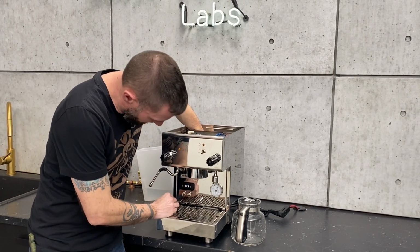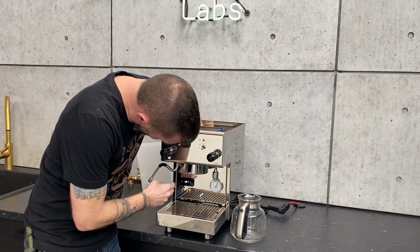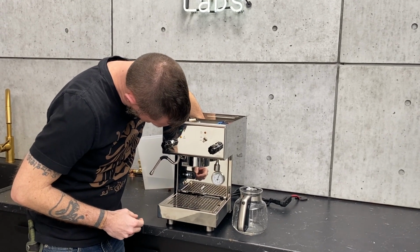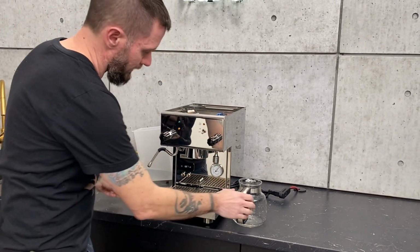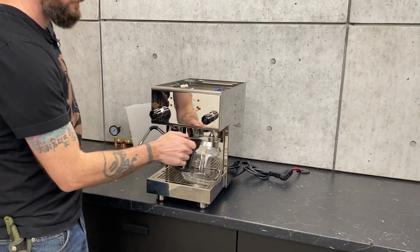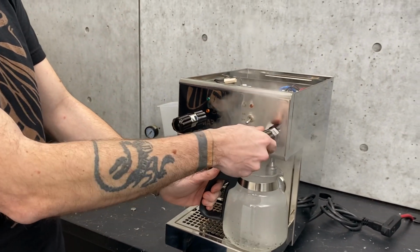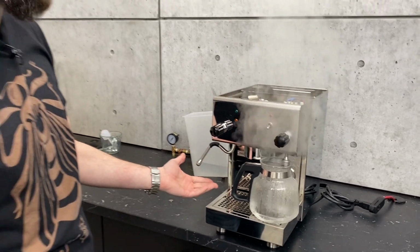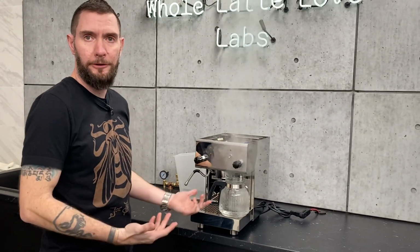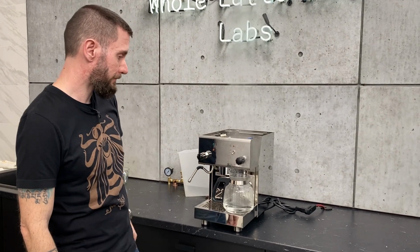I've seen it done before, but so make sure that I got this steam boiler heated up all the way. And click. All right, it's fully heated. So what I'm gonna do is turn the machine off, find some sort of vessel that fits underneath here, and just open it up. Now, turning the machine off is important because obviously, again, we don't want more water being introduced into it. And so it's just the pressure in the boiler pushing that water out through the bottom.